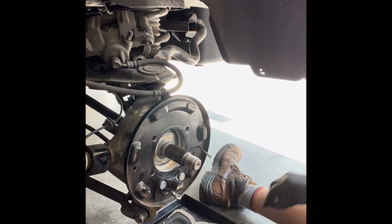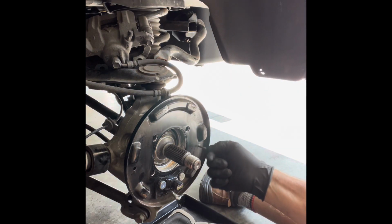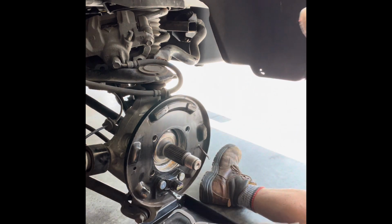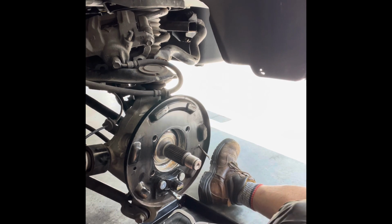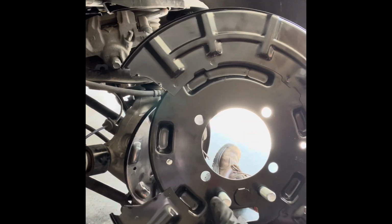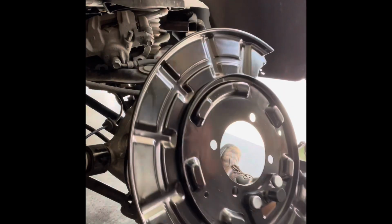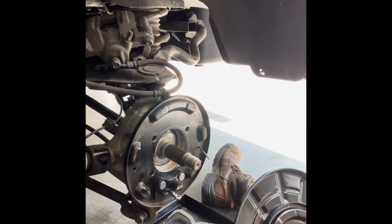Put that over here. Okay, so now we're down and dirty. Remember, the only thing really sticking out are the retention clip or pin and the parking brake cable. So when it goes back together, we know how to do it. The last thing to do is there's 2 bolts right here, and I'll show you on the other plate. There's 2 bolts, right? So this is how the plate sits. Right back here, you got to pull those nuts off. I'm going to do that now. It's probably a 17 millimeter, I don't know. And then that whole assembly should come out and we'll get it cleaned up from then on.